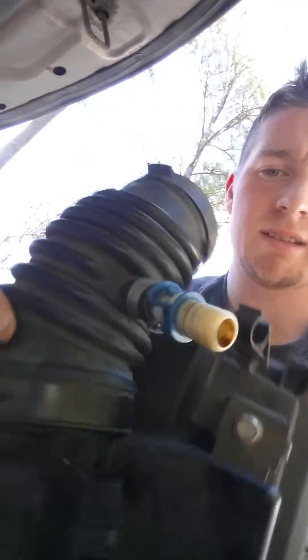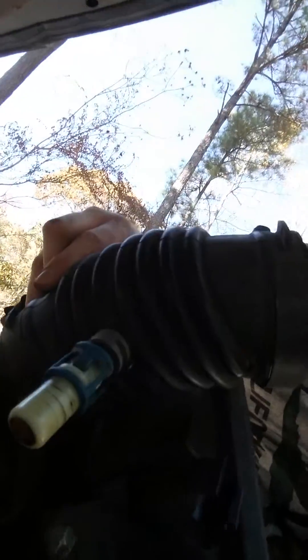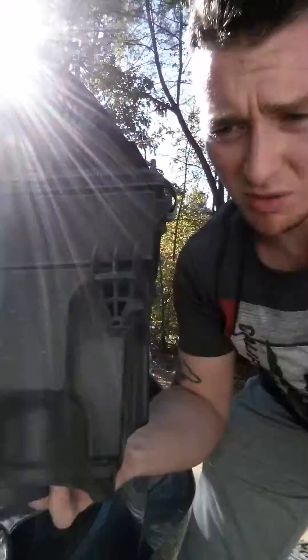I'll do another section of this video after I get done cleaning this baby. So you'll remove the upper air intake box — everything's still connected, mass airflow sensor's still on there, your quick disconnect on your valve breather there. I already cleaned the mass airflow sensor before I got this car back. They said it was having this running rough issue, and it actually made no difference with the mass airflow cleaning. The mass airflow cleaner is only about $7.99 in a silver can. I also took out the base of the box — it just pops off with four clips.